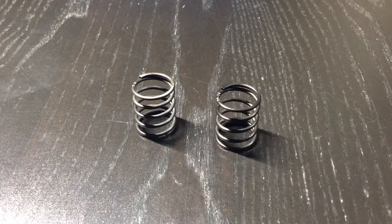However, it can be a little bit too much for some drivers — it can make the car a little bit too twitchy. So if you find that your car is too twitchy with a progressive front spring, you can simply run linear springs front and rear. Most top drivers prefer linear springs because it makes the car easier to drive and more predictable. It tends to be a lot smoother when you're driving on various surfaces.